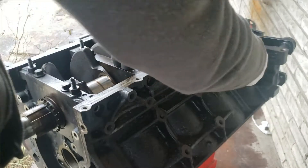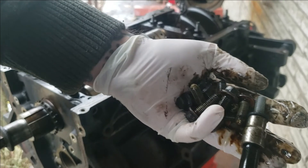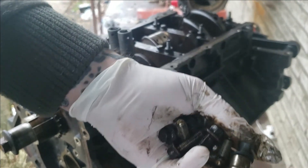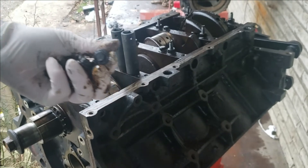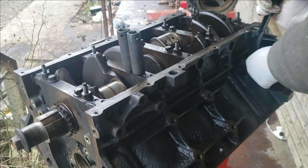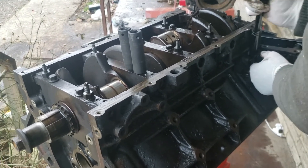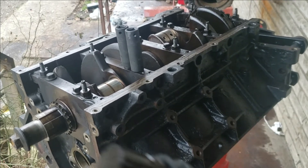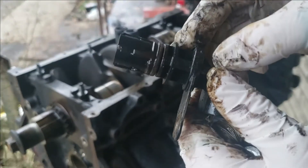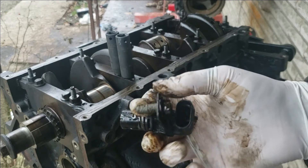Be sure to remove your sensor here — it's a 10mm or so. You can tell the bolt is a bit different; they look almost identical but they are different, so don't get them mixed up. Your sensor will pull straight out and it should have an O-ring on it. Sometimes you have to use something to pry it. The sensor popped right out — I'm going to put my bolt with my sensor so I know where it goes.